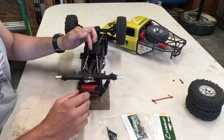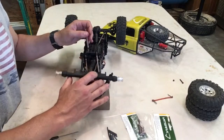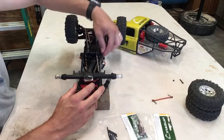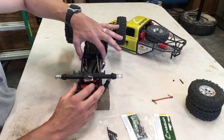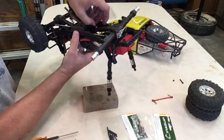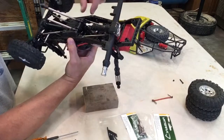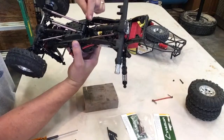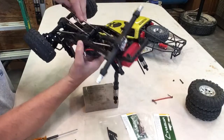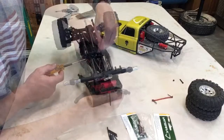And once you've got the axle floating here kind of loose, now we can go ahead and take out the screws here in the frame, go ahead and slide this back. Now I'm not sure if this will come up on camera, but it appears we're going to have an issue right here with the length of this screw. We may have to cut it off, because once it comes back to this hole here, it may get into the drive shaft. But we'll take a look at that when we get there and see if that needs something to take care of.